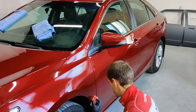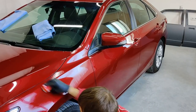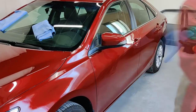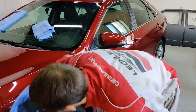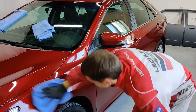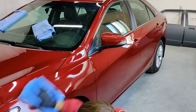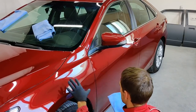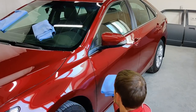It doesn't matter much where you start. The main thing is to work through everything consistently. The temperature right now is quite comfortable for application — you can easily do a whole door at once, split the hood into two halves, the roof into four parts. Very convenient. Make sure to use a clean fresh microfiber. Wipe to complete transparency. Very important: don't stop the cloth mid-motion — the moment you stop, you can see it dragging. When lifting the cloth, peel it away smoothly so no marks remain.